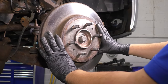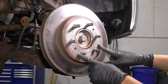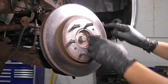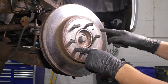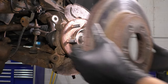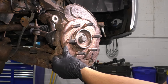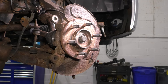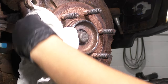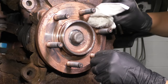Your rotor should now be loose. If it's seized onto the hub and you're reusing your rotor, try to tap right in between the lug studs to break it free — not on the braking surface, front or back, as that will damage it. There are also two threaded holes where you can put bolts through to push it away from the hub. Mine is free, so I'll pull it right off. There's already anti-seize here, so someone's been in before. I'm going to wipe it off now so it doesn't smear everywhere as I work — we'll clean it properly later.